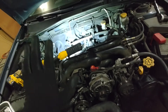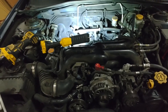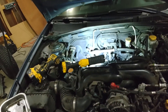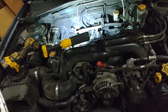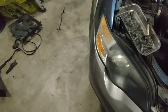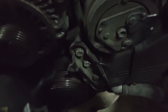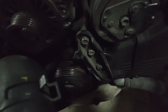I will suggest again: if you're really getting into DIY on any type of combustion engine vehicle, impact tools make a world of difference. I've got my DeWalt 3/8-drive impact and my DeWalt half-drive impact — they save all the effort of trying to break these tight things loose. We got the bolt out of the crank pulley, or harmonic balancer. Now you just wiggle this back and forth until it comes free. If it's a little tight, you can get a rubber mallet and knock it back and forth and it should wiggle right off the crank itself.